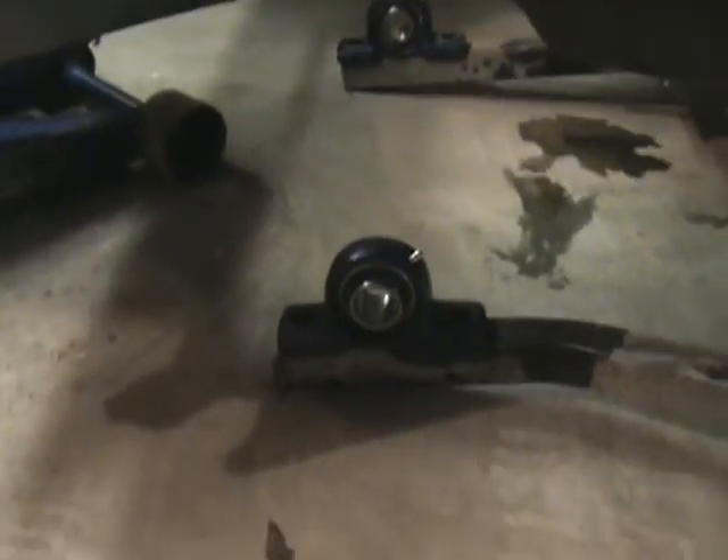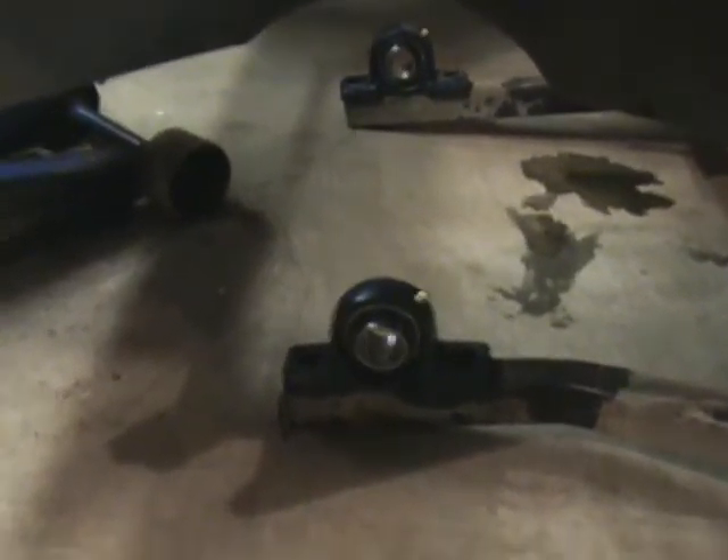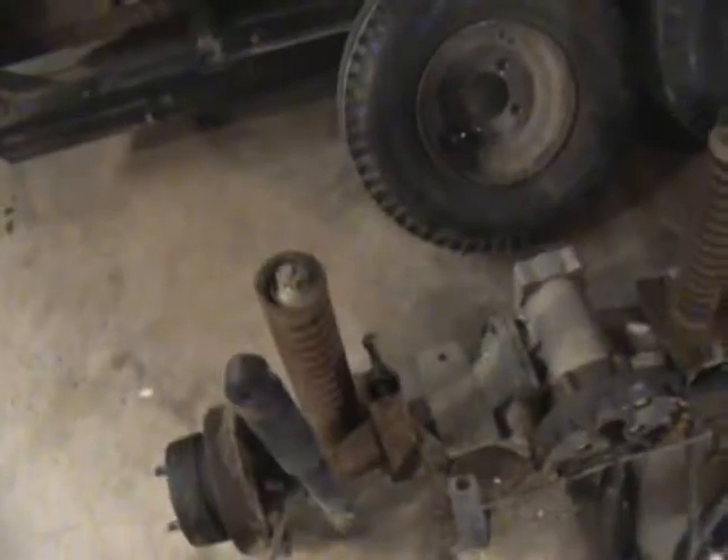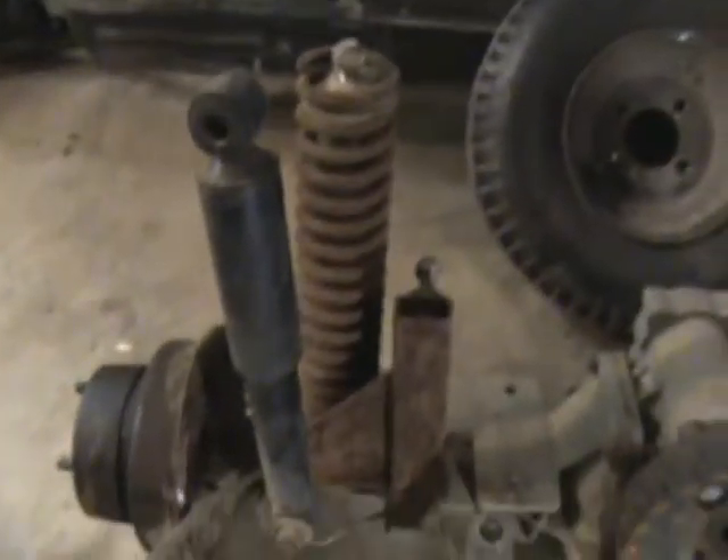For the back end, I'm thinking of just running a straight axle. These are the carriers — I'll probably mount them on the bottom but they're just in place so you've got an idea. That's what I'm thinking. I'll probably end up reusing some of these pieces just so I got the original height, cut those off and get them either welded, make a block or something to make up the difference.